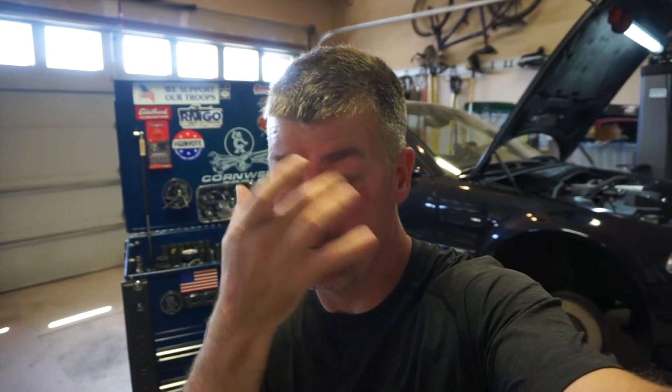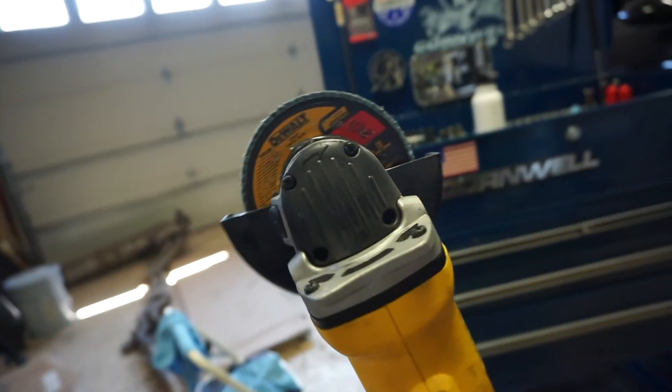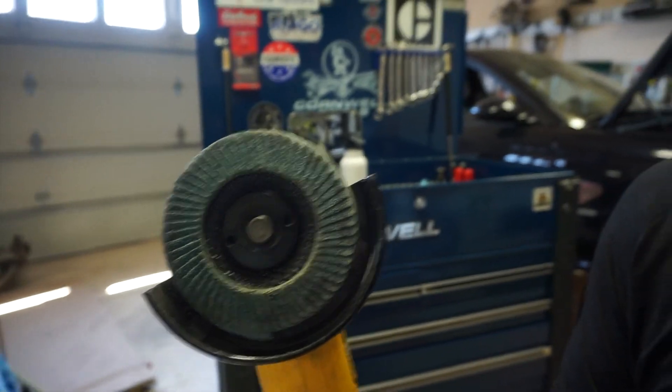I wanted to take this time to thank you guys for tuning in. Also, a reminder: I always wear safety glasses. I got a little bit of epoxy on them while installing — thankfully the glasses kept everything off my face. When grinding, there are a lot of metal particles flying around, so definitely have your safety glasses on. In case you're wondering what I used to grind the material in the bottom of the car: I have a 20-volt DeWalt grinder, and I used the metal etching grinding wheel — it did a great job removing all the material. I'm going to let the plates cure and then spray some undercoating on them. Thanks for tuning in and supporting the channel. If you liked what you saw, please click thumbs up, and subscribe for more content like this.